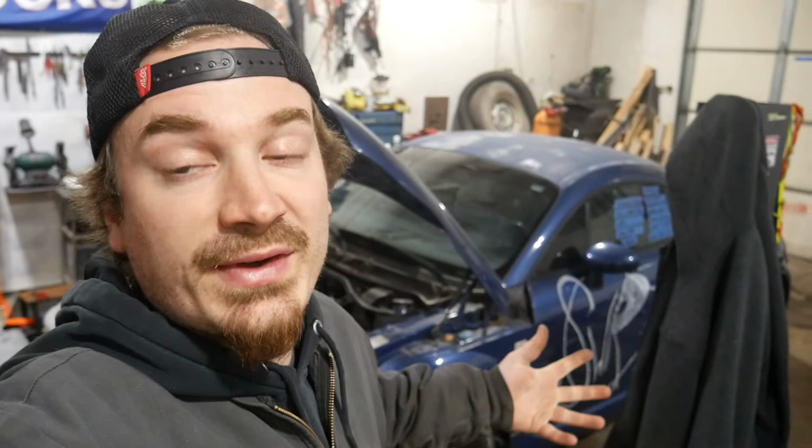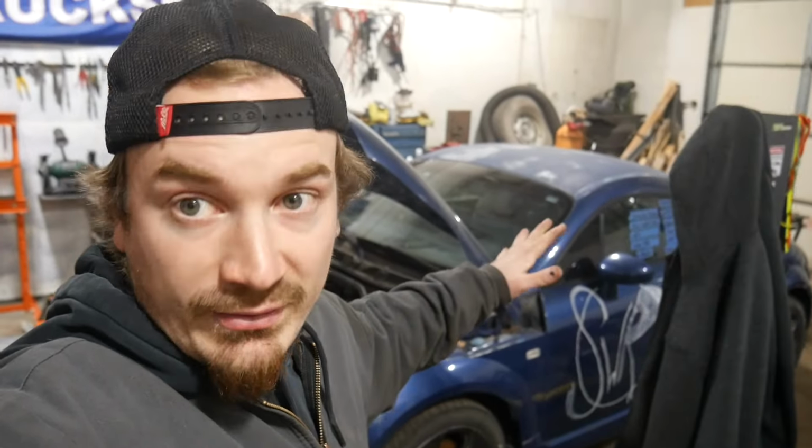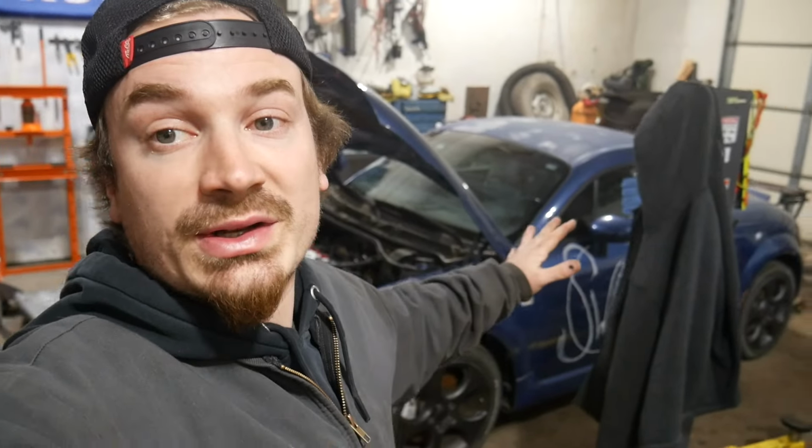A lot of people call this fake all-wheel drive. Well, there's going to be a process here, and the long and the short of it is we've got to remove the front axles. We have a whole spare diff and Haldex assembly, but we're going to weld the diff. And then comes the fun part, which is we're going to get a plug-and-play Haldex controller, which is going to split the power 50-50. And then, because we're not going to have front axles, all that power is going to get sent to the back. Now, why are we doing this with the Audi?